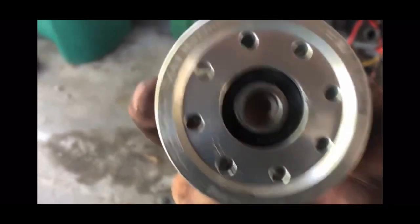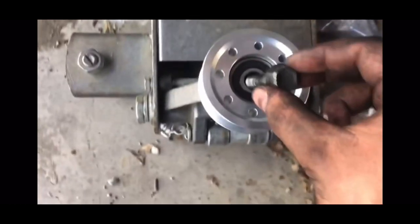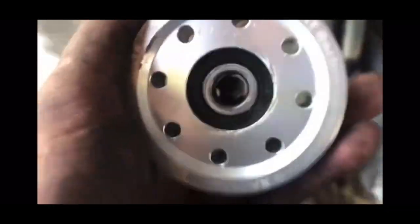For the idler pulley, you're guaranteed not going to use the washer because it seems like it'll stop it from seating. When I tightened it down, I noticed it was wobbly. To fix the wobble on the idler pulley, you want to push the bearing towards where it says 'Zat Racing.' What I did was put it face down with a towel so I didn't scratch anything, put the bolt through, put a socket on the bolt, and just hammered the socket a couple of times. Put it back on and now it's not wobbling. You just got to get the bearing seated and then it'll be fine.